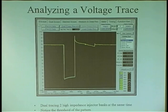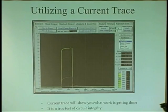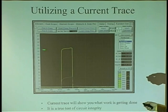That's the problem. You need to look at amps, because the other part of Ohm's law is the amps. Look at this. It's pulling 13 amps. So the computer's going like this, right? The computer's going like this. Who's your daddy? Whoa, you're my daddy. It doesn't want to pull, because it knows if it brings it all the way down to ground, it's going to burn itself out. So it's going to hold it at a certain level to protect itself.